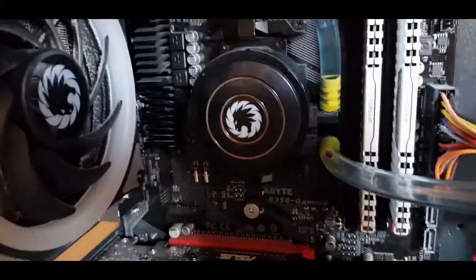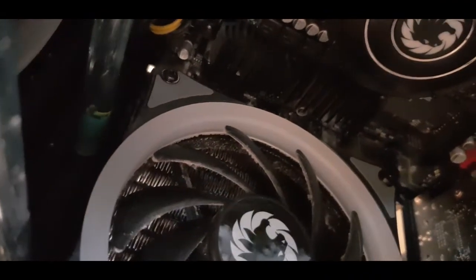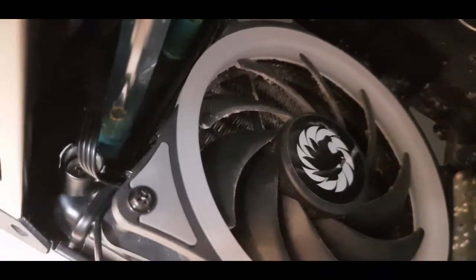So managed to get it all plumbed in. So the way I've got it running is, I've got the fluid in, the coolant stuff. I've actually submerged the pump. I thought it would be easier than having to make small connections. So I've submerged the pump, it's going to push it out, and then it's going to go up, out of this one, across here, into the bottom of the cooler, around the cooler, and it's going to go up into the radiator, get cooled, and then come out this side, and come all the way back, and then return. I don't know if you can see it, but it's just at the other side there on the left. And I went with 2 wires coming out here.